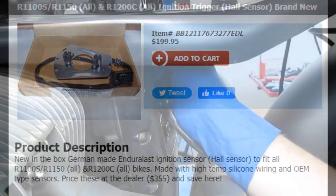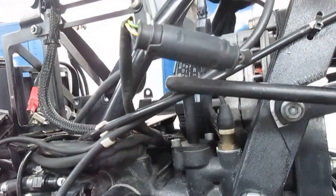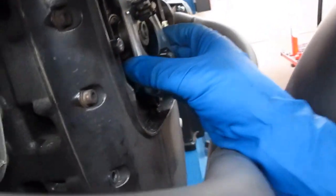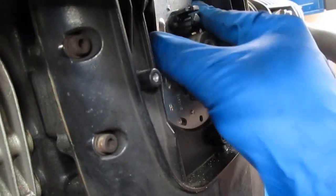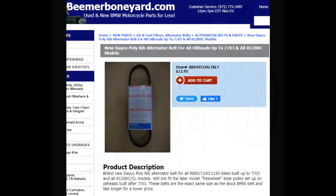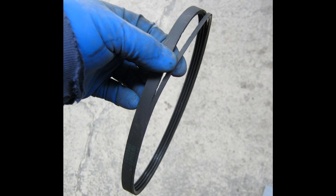You can have a hall unit go bad — you can see the electrical lead through here. They're susceptible to overheating, so a bike that sees a lot of heavy stop-and-go traffic use is more likely to have a hall unit failure than a bike used on Sundays that keeps moving along at a nice pace. The alternator belt is as prone to failure as the rest of them — not saying they're prone, they last a long time. You should replace it at 36,000 miles. I have seen them make it into the 50,000-mile range, but they do break then — they get old, they dry out. There's only so many times that belt can turn around the pulleys.